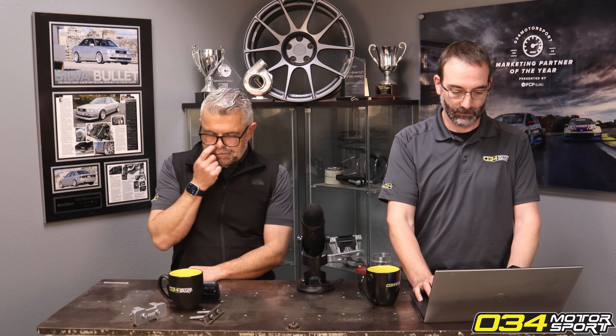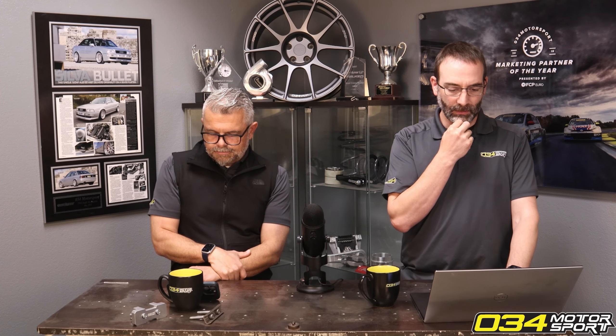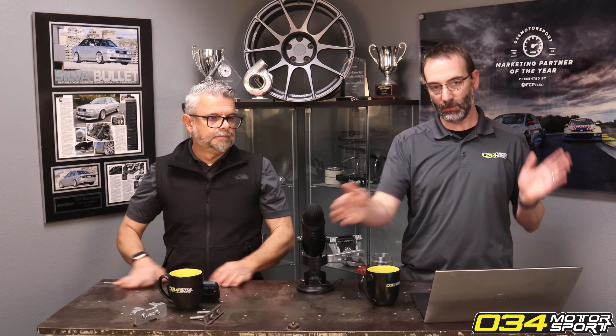The question is about open versus closed air intake on the B8.5 S5 — will an HX mitigate some of the higher IATs with open air temps, or does it not matter? The intake air temp is not really an issue with our intakes. There is no elevated IAT — it's shielded nearly directly to the hood, and all the fresh air inlet comes from the original scoop that comes up over the radiator.